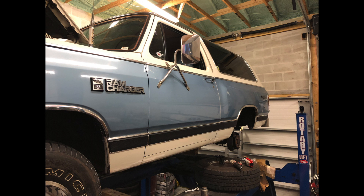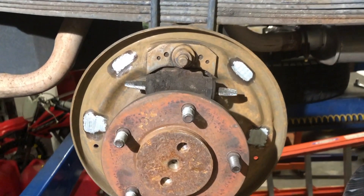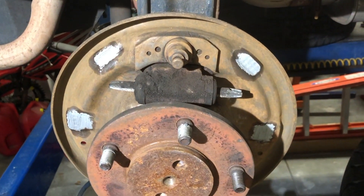These vehicles can be a bear to stop, even more so when towing, so a quick sneaky way to upgrade rear bias and increase stopping power substantially is to upgrade the wheel cylinders. After removing the tires and drums, inspect the brakes for wear, damage, or missing parts.